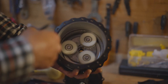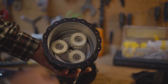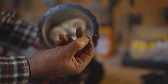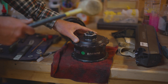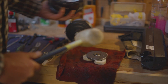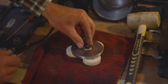At this point we want to make sure that the planetary gear system in the new hub is removed to be put into the existing hub. Keep in mind there's a small spacer on the inside — keep an eye on it to make sure it's put back in when reassembling. You can place it on a bench and tap with a mallet. Once you have the planetary gear hub out, keep in mind not to lose the two spacers on the outside.